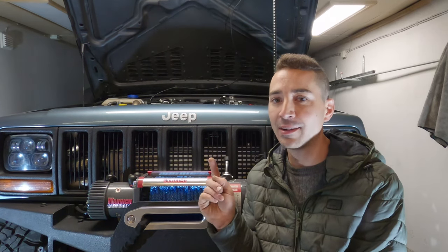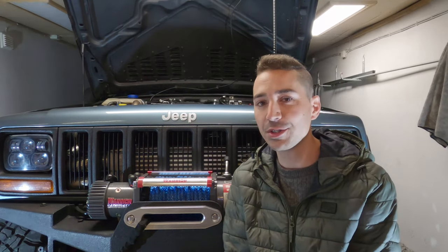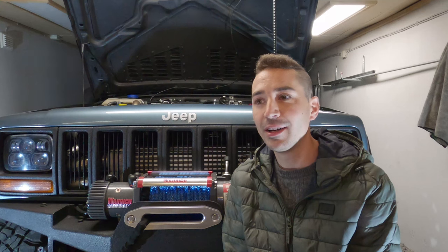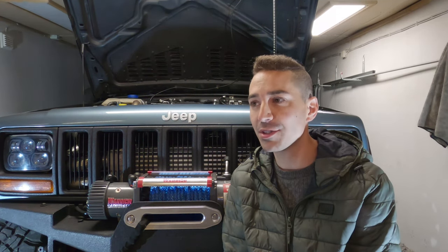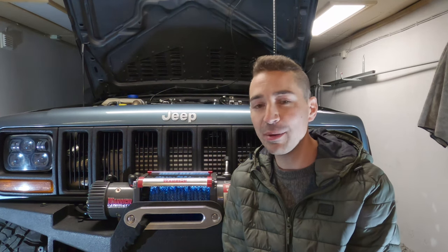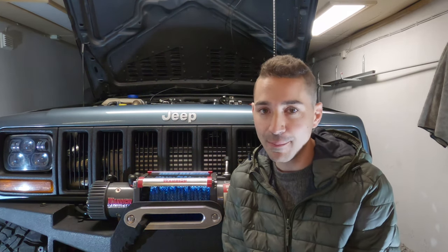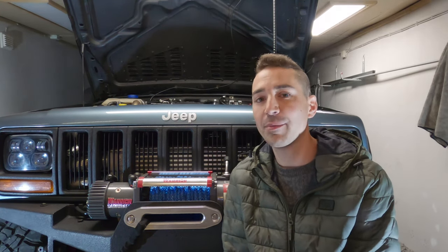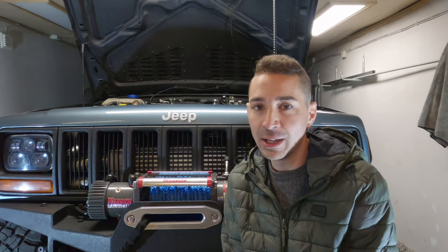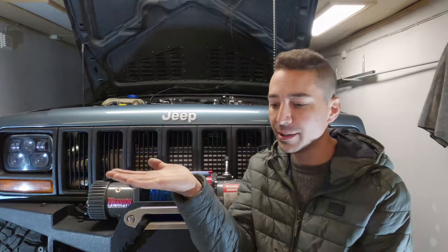as you possibly can, because the EGT is only an indicator. It's not telling you what's going on inside the combustion chamber. I had 650 on that EGT gauge, but maybe I was at 750 or maybe more inside the cylinder. So how long can that piston operate at that temperature? I mean, it has a few things going for it, and there's a lot of other factors that come into play. For example, it's being cooled by oil. It's not actually directly touching the explosion, hopefully.